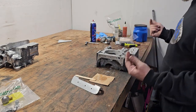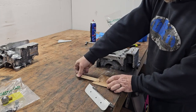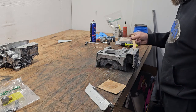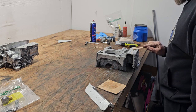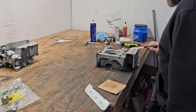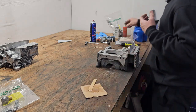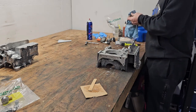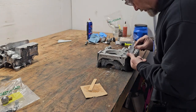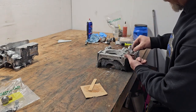I put the bolts coming out — probably looks better if they were going in, but I'd like to be able to see the nuts to make sure nothing ever comes loose, and it'll be underneath the edge of this mount so you're not really going to be able to see it anyway. I coat this whole area with a nice layer. They're not lock nuts, but I'm going to put epoxy on the threads, and when I put the washer and nut on there while it's wet it'll seal it down into the crack. A good part of this is just to make sure it doesn't leak oil.